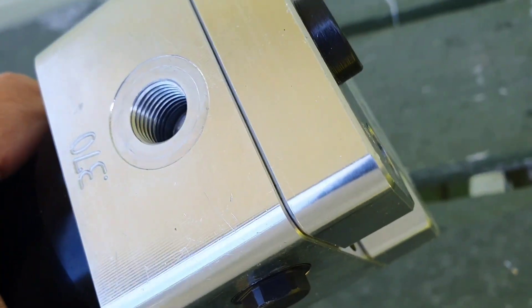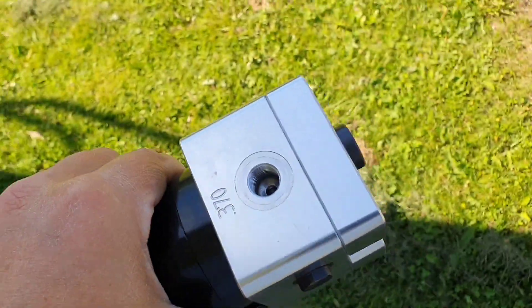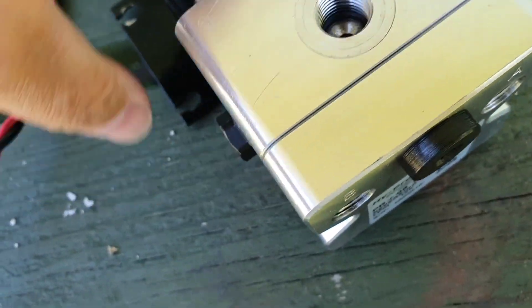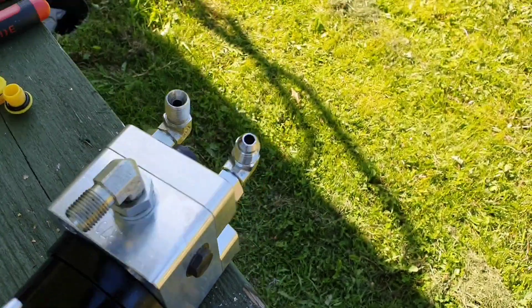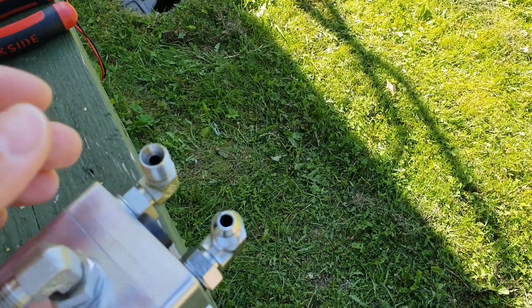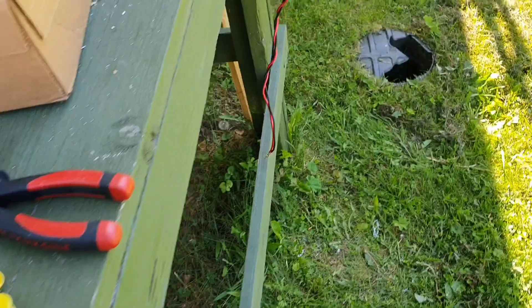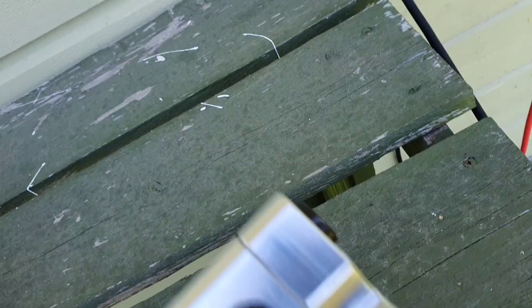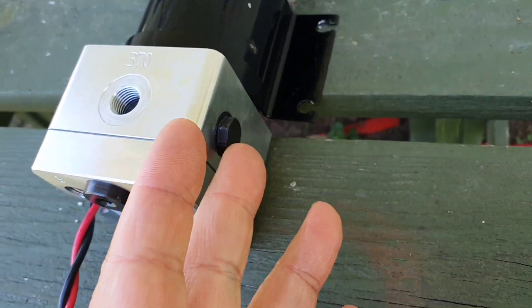Can you hear clicks? I will try. No, let me try here. No. You should hear this. And I have seen this valve moving on the old one. So nothing on the new one. I will try this test with compressed air and let's compare. I put air here and I feel air from both. If I lock one, I don't feel pressure on that one — all pressure goes from the opposite. But if I put air here, nothing comes from here — the same as the old one. But nothing clicks, no clicks of the valve, no movement of the valve that I could clearly hear. My strong suggestion is that something with the valve has happened, especially after we discovered metal shavings in the thread.